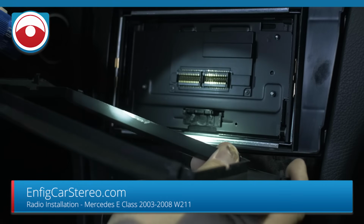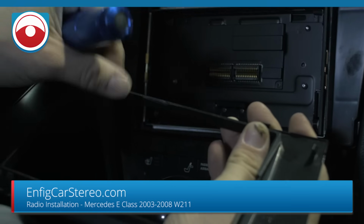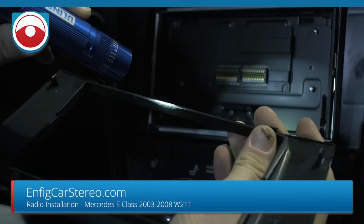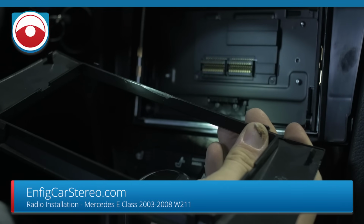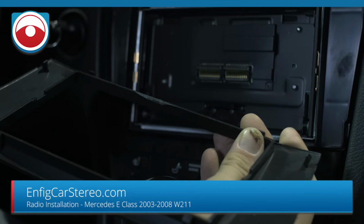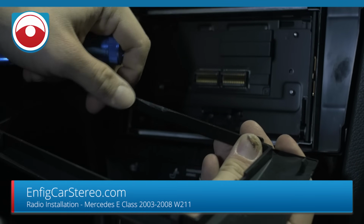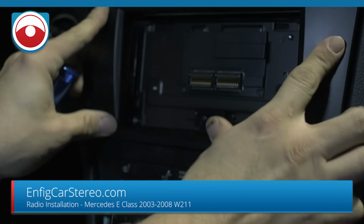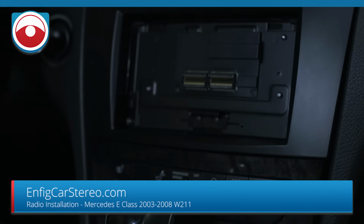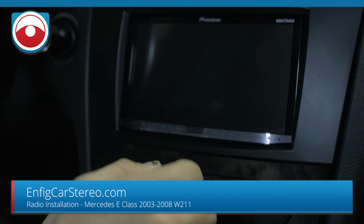All right, guys, so pretty much I didn't even Dremel it, I just went with a hand file. What happens is you make the thickness of this back here thinner where it hits, so that it doesn't catch. It's almost like an on-ramp for handicap people going upstairs. Instead of having this big lip, you have a smaller lip, and it gradually goes up, exactly like a ramp. So I'm going to put that in, put this back in here.